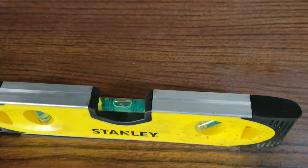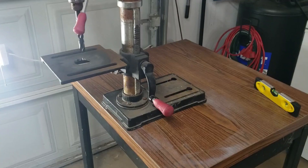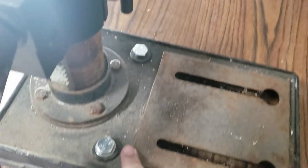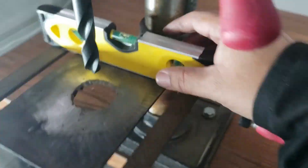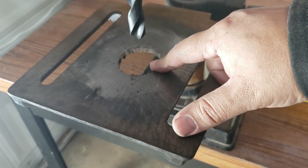First step: I'm going to put the drill press right here on my table, bolt it down so it hangs off the end — that's where I'm going to put the axle to be able to drill into it. I've got it level both ways. I pre-drilled some holes on the table, bolted it down, and made sure everything was level. I also made the hole in the plate bigger so the whole axle could fit through, and I'm going to use some extra wood on the bottom to hold it solid.